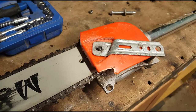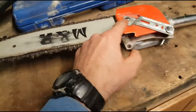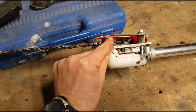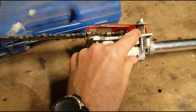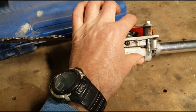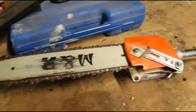I'm going to put it back together now so you can see what it looks like reassembled. Everything's back in place: bracket in, lock nuts tightened down, self-tapper in, spacers in. The orange housing sits just on top of the spacer — it doesn't cover over the hole, it just sits about two millimetres over — and as this tightens down it's just gently squeezed into place. Not overtight, just enough to hold it securely.